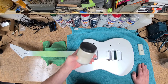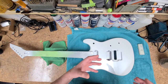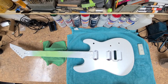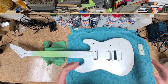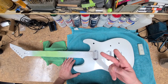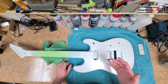You could add this crushed pearl to any color, and depending on how much reducer you put in there, you could thin out the paint to get a nice mixture of the pearl and color — and it ends up looking like what you see now. I'm learning a little something with these custom colors. What I'm going to do is — I already hit it with the white, I'm wet sanding it now — so I'm giving the next color something to bite into when I start spraying.